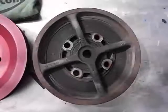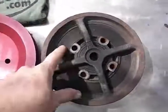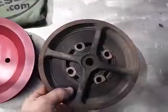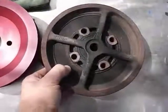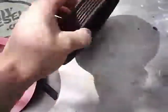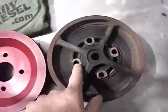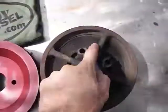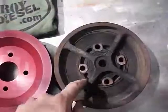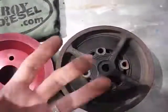Here is the factory pulley. The problem with them is they have this rubber isolation piece — it's a two-piece pulley and they are constantly separating. This one is pretty soft; it feels like it could let go at any time, but it's actually not cracked or separated. They either separate around the ring all the way, or they'll physically crack right in the rubber itself and then separate.